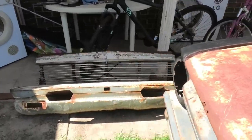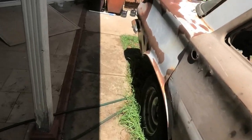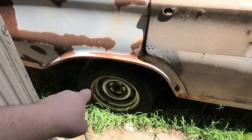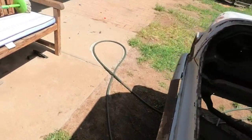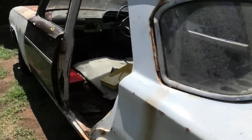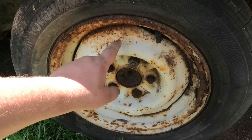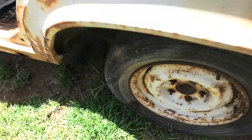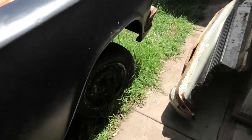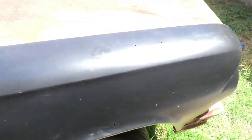Now for some wheel identification: that's an H-series wheel. Tarana wheels — like this widened Tarana wheel — share the same stud pattern as an old Holden, so Tarana wheels bolt straight onto old Holdens and vice versa. This here is actually an HR wheel — it's got raised nubs and you need these rims if you're going to put a disc brake front end on an old Holden, because they're designed to clear the calipers. Whereas over here this is an EJ or EH wheel — they're triangular and flat through here, so they're the correct style for this car.